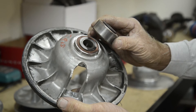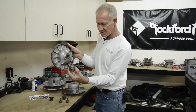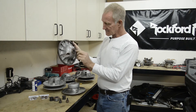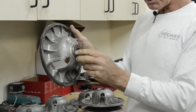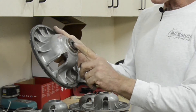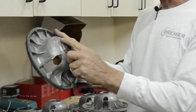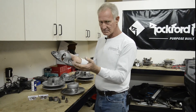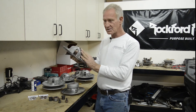The front half of the sheave is held just by this bearing and this steel sleeve. We have a couple of extra sleeves here to show you what they look like, along with the bearing. This one is obviously shot. What typically happens with this type of assembly is that the grease is blown out of the inside after a lot of riding. The bearing seizes momentarily and spins in the housing — a lot of that is caused from never replacing the bearing. At Premier Clutch, every single clutch we build gets a new bearing.